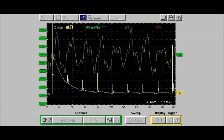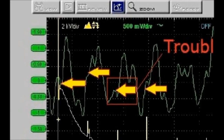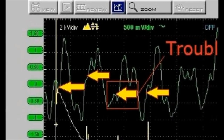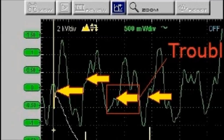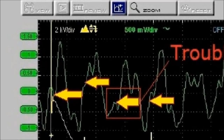After each spike — in other words, after each ignition event — you're going to see a waveform crest. In this particular case, the firing order is 1-3-4-2 on this four-cylinder engine. The third arrow that you see there has no crest whatsoever. That tells you that you have an issue with cylinder four — in this case, the vacuum signal. There's got to be an issue with either valves, piston rings, or maybe a worn cam lobe, because you're getting no signal.